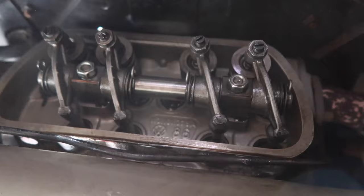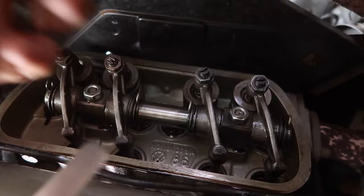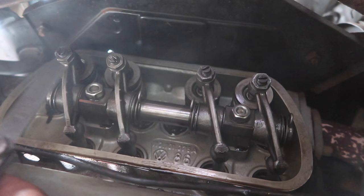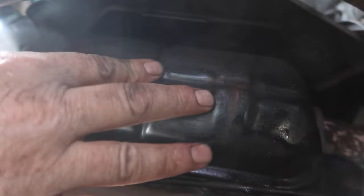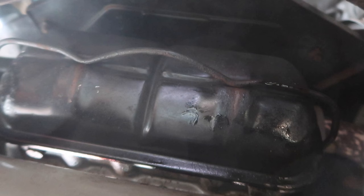I feel like I got this side adjusted pretty good with the six-thousandths feeler gauge. I did cylinder one, now I just did two. I'm gonna put the cover back — it doesn't look like it was leaking from here at all, the gaskets seem okay. I'm just gonna put them back for now. Make sure it sits good and then this clip just pops in — there it is. That's it, it's that simple.